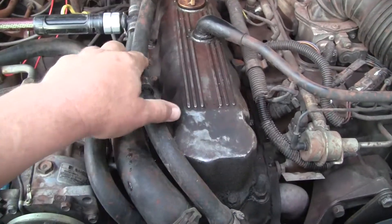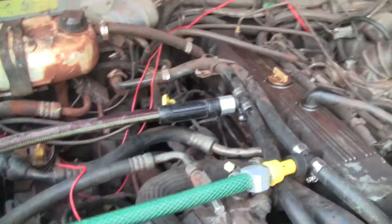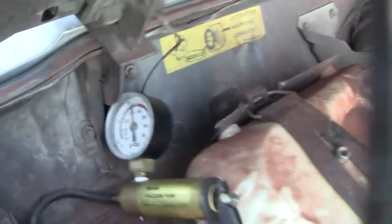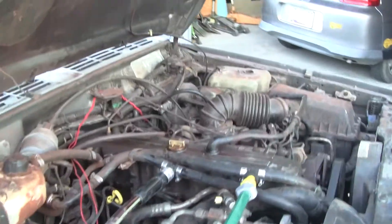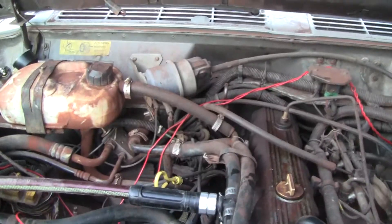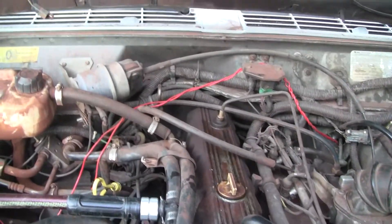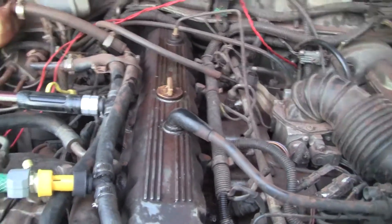It pressurizes and goes both ways — this way is toward the heater valve and the heater core. The heater valve right here has a vacuum line on it, and what I do is pump it up so that it's open and the core gets flushed. You turn your water on, it starts filling the system up, then it exits out this hose here and goes far away so it doesn't stay in your driveway.